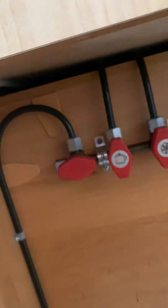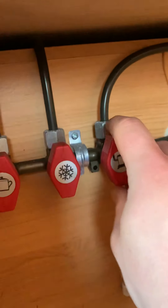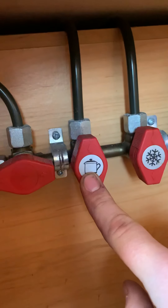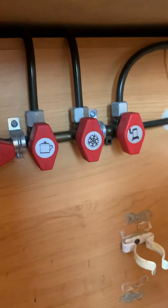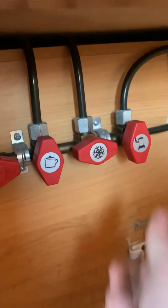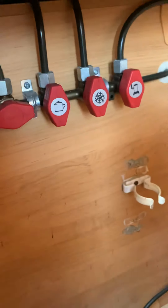You've got a couple of bits in here — the gas manifold. This one here is coming from the gas locker, and this one here is for your heater, fridge, and the cooker, and there must be some kind of external point somewhere. It's basically just an isolator — you can leave it how you want. For example, if you're on holiday and you thought you had a problem with your fridge on gas, you can just come here, switch it off, and carry on with your holiday, because that will stop the gas coming from there to your fridge. They work really well — they won't let a single bit through.